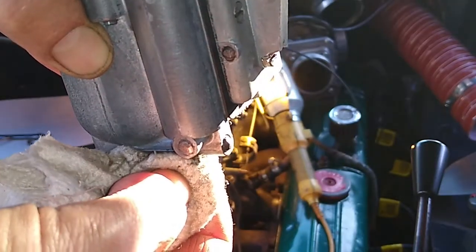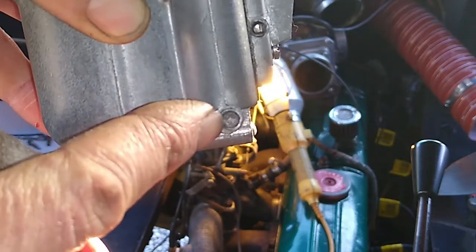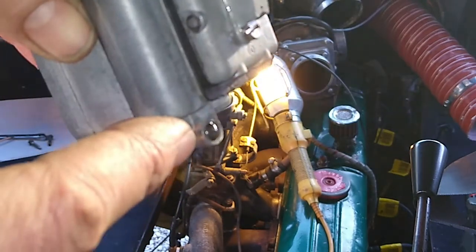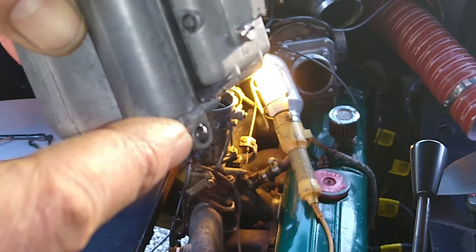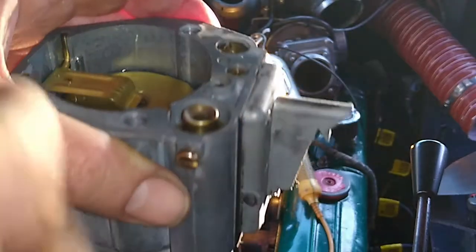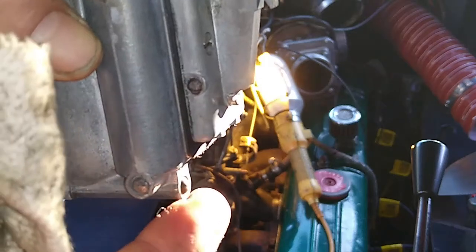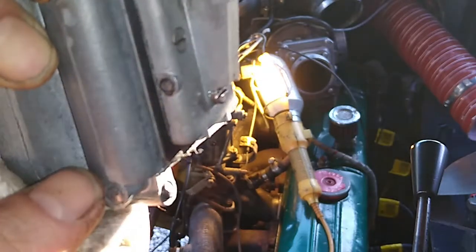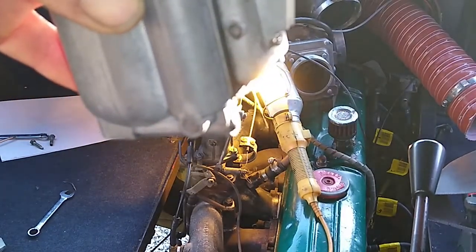It would come back, but I've figured out what it is. There are lead plugs in the drillings - lead plugs which are hammered into the side, and there are a number of these. There's one here - you see how that's shiny? That lead plug is a little bit loose. So when petrol sits in the float bowl it leaks down the drilling and drips off the bottom of the carburetor. It's always done it and always annoyed me, and I never figured out where it was until about 10 minutes ago when I was looking at it in the sun - I wiped it away and you could see the fuel glistening on that bit as it came back out.